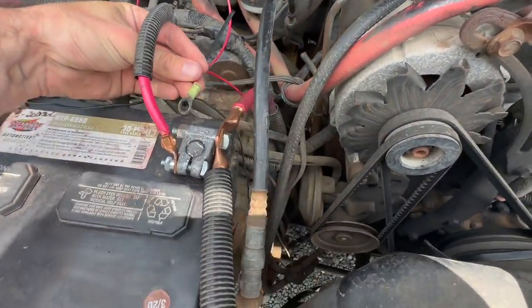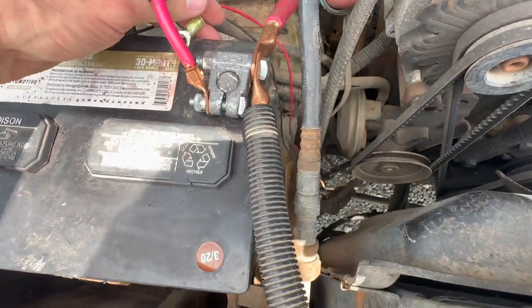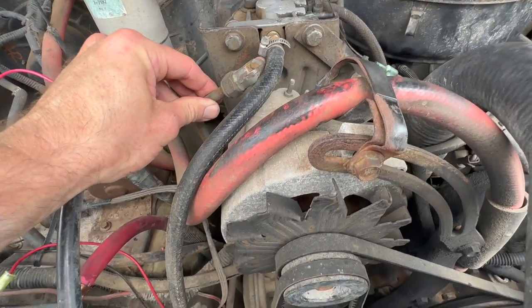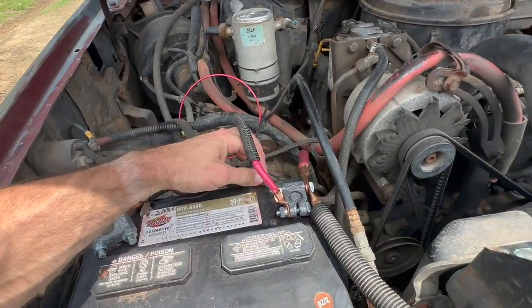What's plugged right here — you probably hear that clicking? That little fuel pump down there — it's hooked to that little fuel pump. It's an electric fuel pump. That's why this soft line here, and this is deleted. My question is, they still got the mechanical — if anybody knows this, let me know, because I'm trying to learn. They still have the mechanical pump in there, and I know they make a block-off plate. Is it all right if I run with the electric pump, with the mechanical pump still there, or do I need to take the mechanical pump out and put the block-off plate? It seems to be running fine.